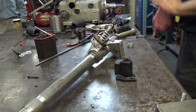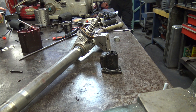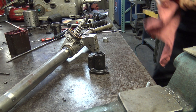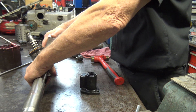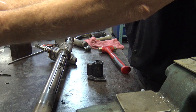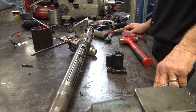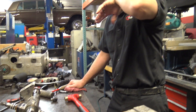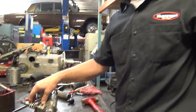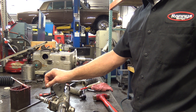Steering racks are different. Yeah, on a left or a right-hand drive, this would be facing this way — this housing would be on this side. It's just totally different. On the Silver Cloud, the spool valving will be the same on either one essentially. It's just the housings are different because they're oriented on the opposite side.